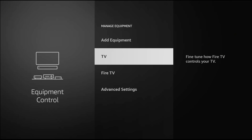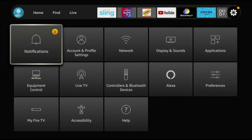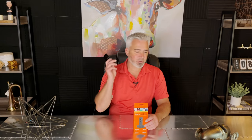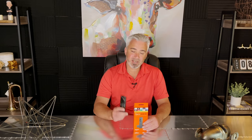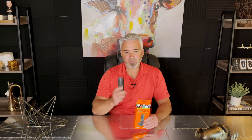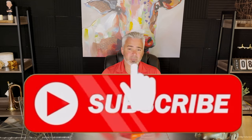Now I have complete control over volume — as you can see right there — and power. I can power my TV off no problem. By doing those three steps, I now have complete control over my Fire Stick and my TV. You don't have to throw that remote control out the window. Follow these steps — batteries, re-sync, TV settings — and you shouldn't have any problem reconnecting your Fire Stick remote to your device and your TV. Thanks everybody for supporting the channel. If you're not subscribed, please click that subscribe button, hit that thumbs up, and comment below any questions you might have.